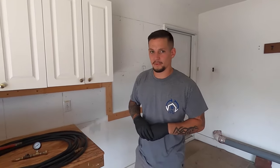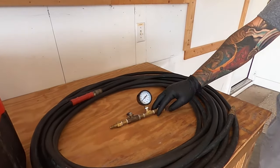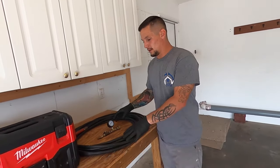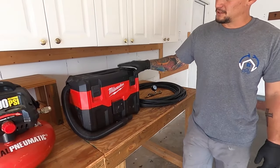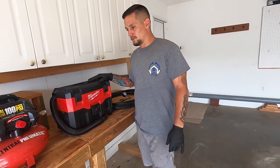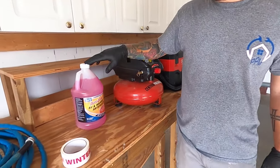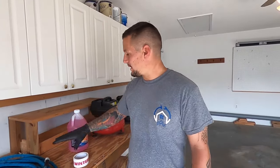These are some of the things that we use while doing a winterization. The first thing you're going to notice is an air hose and a pressure gauge. We will use the air hose and the pressure gauge to blow out the water lines. The next thing you'll use is a shop vac — we picked this one up at Home Depot for a little over $100 — and it has really proven to be the ticket for cleaning out these toilets and toilet bowls. You'll also need an air compressor hooked up to power, antifreeze, your winterization postings, and a water hose to drain the hot water heater.